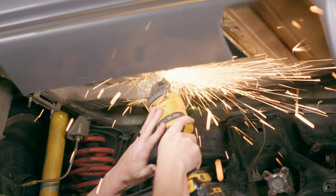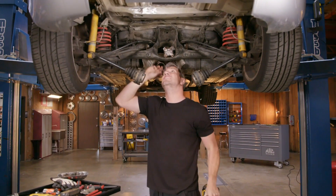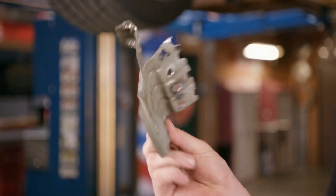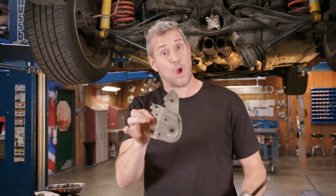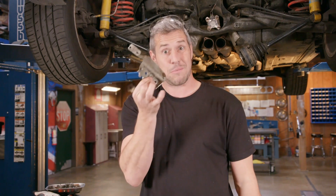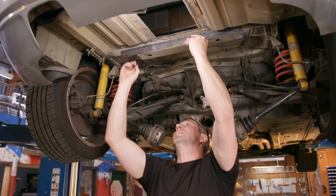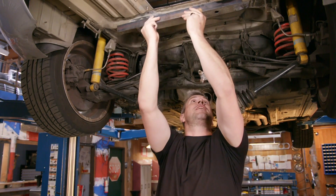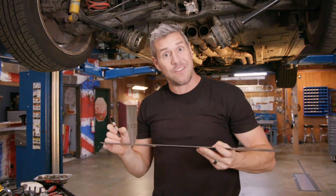With the plate out of the way, the little spot welds can be ground up. That bracket I've removed is pretty much bog-standard steel — the difference is it's quite thin. I'm going to be putting loads of steel back, just thicker than this. Cars like this are deliberately driven with spirit. Combine that with the fact that it's made out of rather thin steel and of course you're going to have a problem.